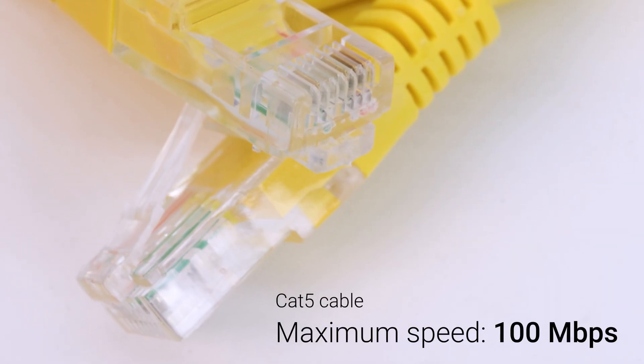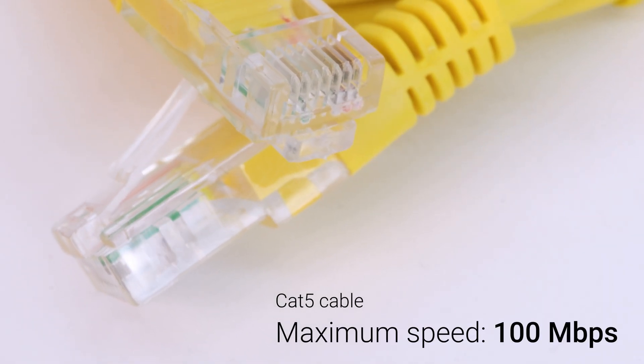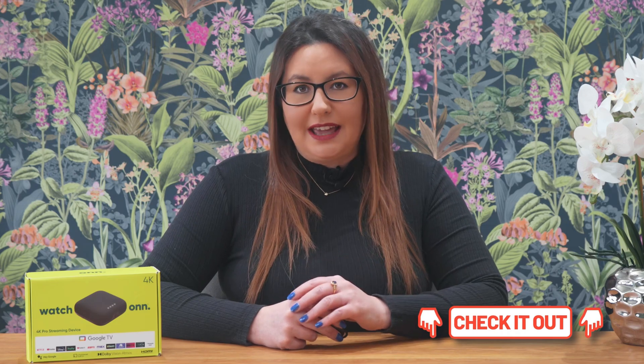Just be aware that you also need to make sure you are using an ethernet cable that is capable of reaching gigabit speeds. Cat5 cables have a maximum speed of 100 megabits per second, so if you're using these cables, you will need to upgrade your ethernet cables to either Cat5e or Cat6 to support gigabit speeds. I'll leave links in the description and pinned comment below this video if you want to check out my recommended gigabit adapter and ethernet cables.